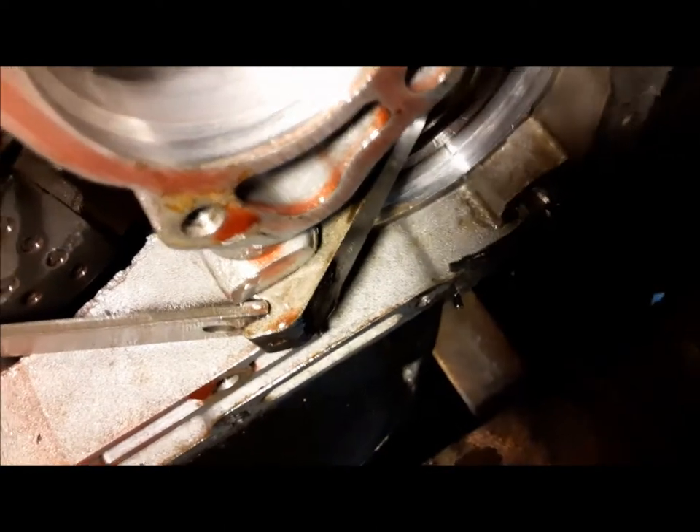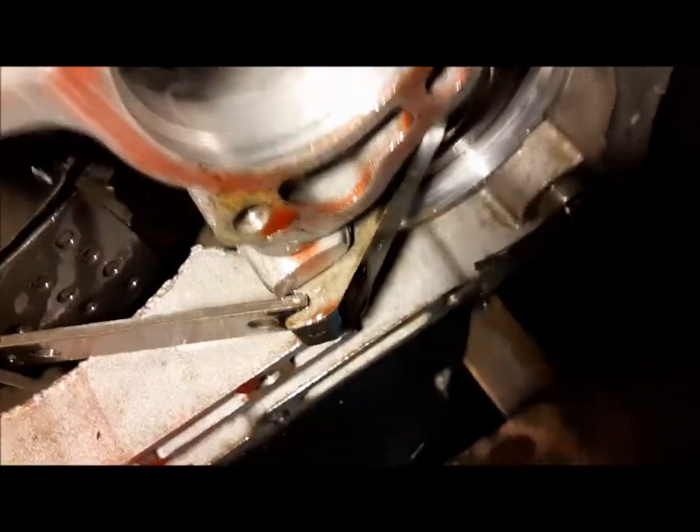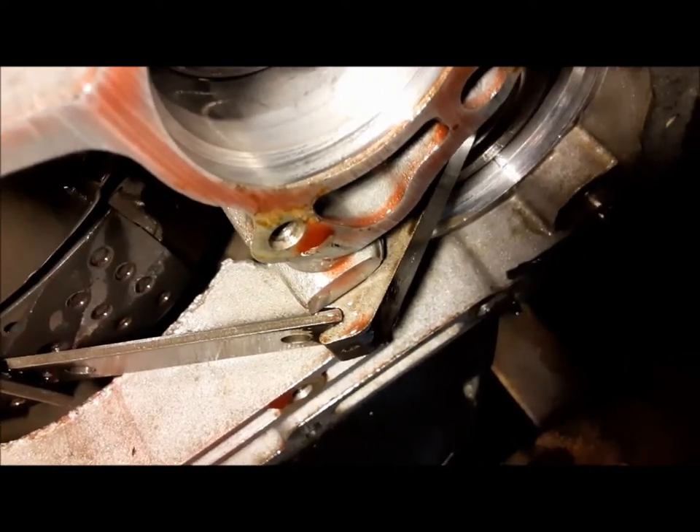Another thing you can do with these: this here is your kickdown clutch apply lever, and there are many different ratios you can get on these. Most of the ones you'll find are in the threes — like a 3.5 or 3.8. What we used to do on our street cars back in the day was change this to a five-to-one lever — a Hemi kickdown lever, because that's what they used in Hemi cars. But you have to have the transmission out to do that because the pin goes through and is held by a plug behind the torque converter. For what we're doing here, this ought to be just fine.